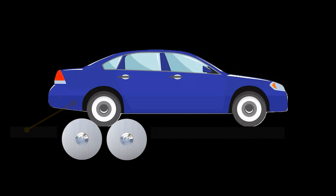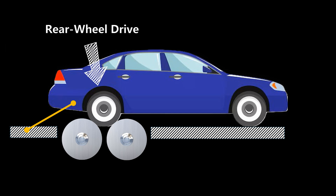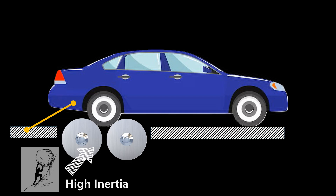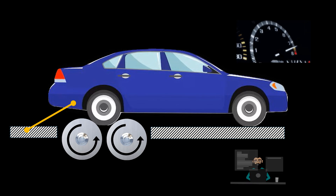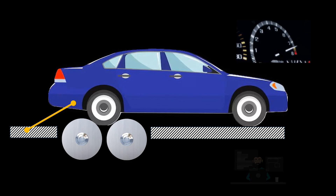Basically, it works like a roller dyno for cars. The car does not move on the dyno — it's fixed with belts to hold it in place. The driven wheels of the car drive the rollers of the dyno. The rollers have a high inertia as resistance, and at the same time, the speed and acceleration are measured via the rollers during the acceleration of the car. A software then calculates the power and torque of the motor based on the speed, acceleration, and inertia of the rollers.